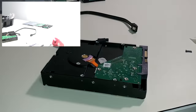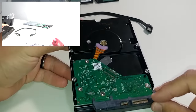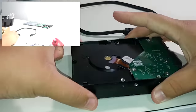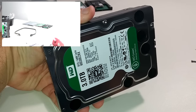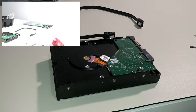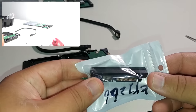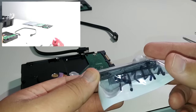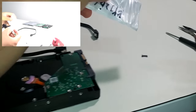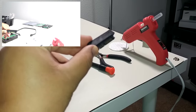What I want to do is explain how I'm going to go about fixing this hard drive. Because in order to take the PCB off and replace it, it would have to be reflashed — sent in to possibly Western Digital or some type of data recovery service to get that done. So I'm going to do a cheap fix right here at home using this L-shaped adapter. It's a 22-pin female-to-male adapter, and that's exactly what I'm going to be using to fix this.